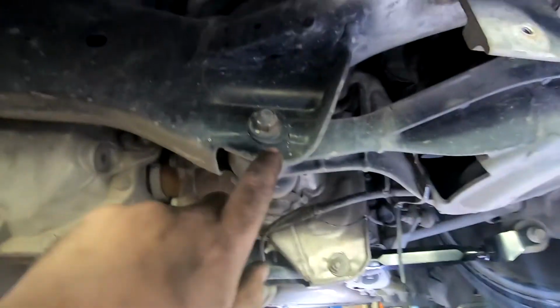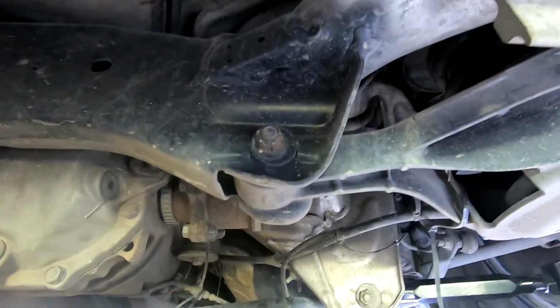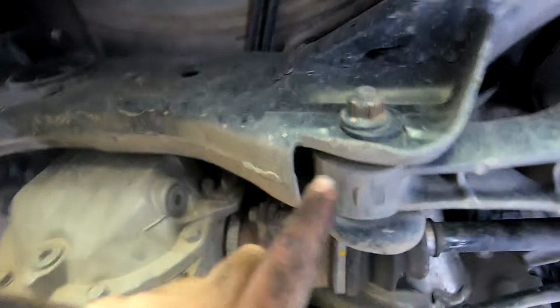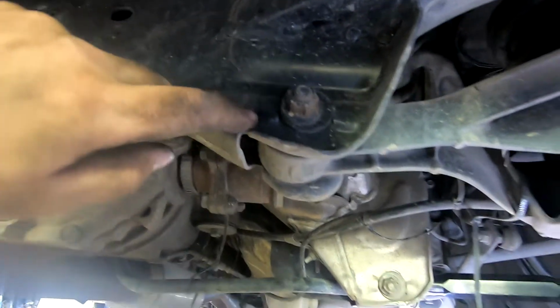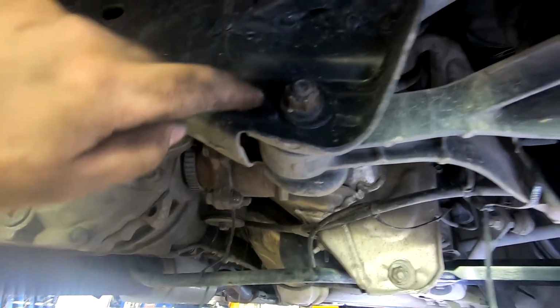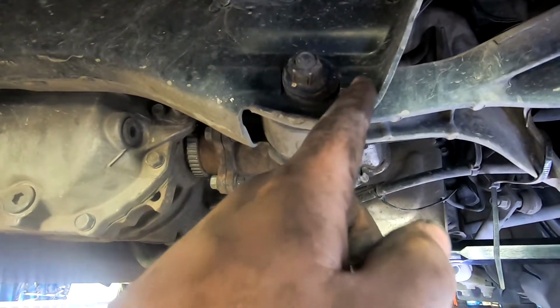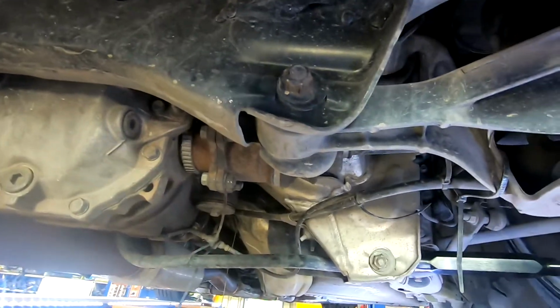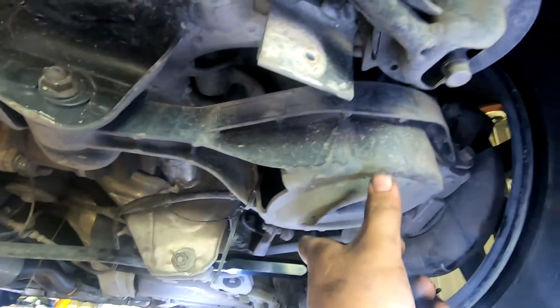But I am thinking about possibly, this is probably an idea more for the 350 rather than this car, but you could possibly get more adjustment out of this by modifying the actual subframe. So if you notch this out a little bit, for enough room for this to move in and out a bit more, you could essentially grind this tab down, so maybe back here somewhere, grind that down, and then weld a little tab in to about here, over here, to essentially move this eccentric bolt over a little bit. The only downside with that is it's going to move the bucket where the spring sits in, but all the aftermarket ones have the adjustment here anyway, so that would do the same thing.